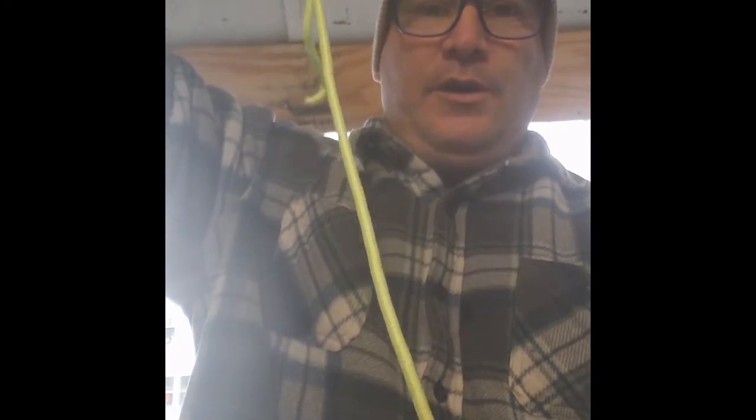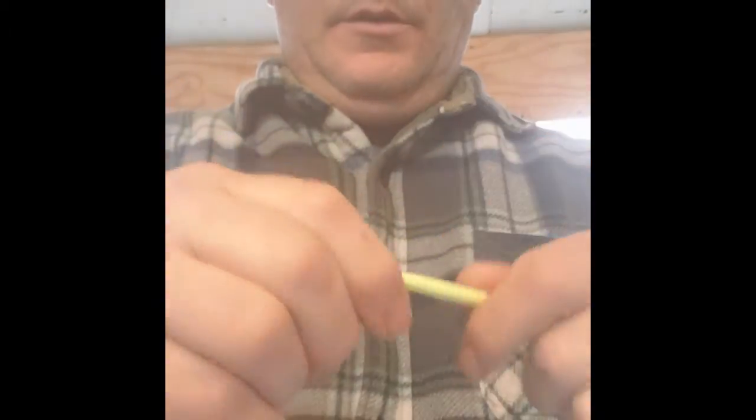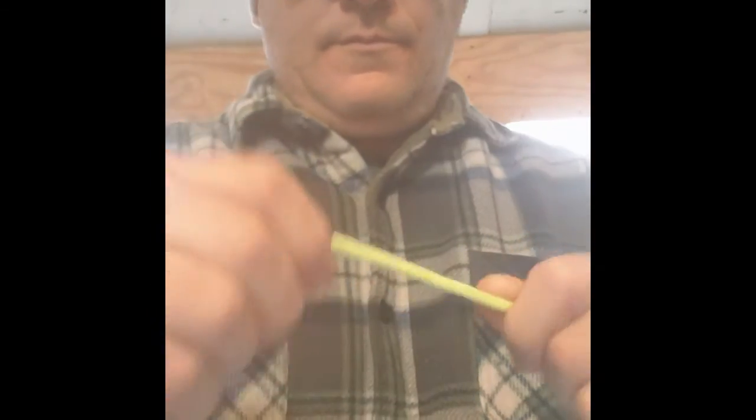So now here's the trick. If your pull string breaks and you go ahead and you remove your coil, you remove anything that's in the way and expose the crank like I just did, you go find yourself a piece of rope, 2-3 feet long, that's it. At that point, on one end, you make a double knot. There you go. Double knot on one end, and you're going to have to hold it on another.